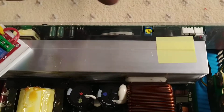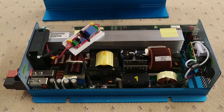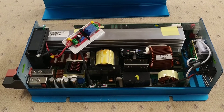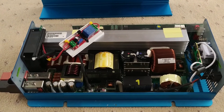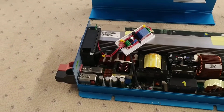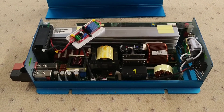There's also a little PCB-mounted speaker in here - you can see the little black thing - that's an alarm. I don't remember that going off; I know the one in the Victron bleeps occasionally. If that becomes annoying I may wire it into this circuit as well, or even remove it since I don't want it bleeping. But for now I've got control over the fan, and I've tested it on the fridge - it's doing what I want it to do.